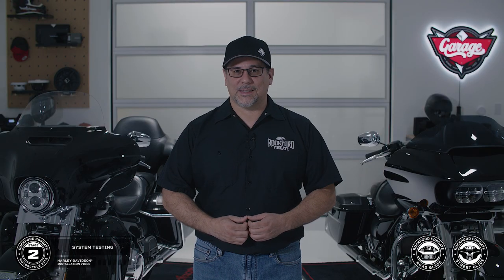Now we're ready to test the system. If you haven't had the factory Harley-Davidson radio flashed, now is the time to do it. Refer to your tuning guide for testing procedures and make any adjustments as needed. If your radio is not flashed, keep the volume at a minimum or you will damage your speakers. You can also find a list of dealers that can flash your radio on our website at rockfordfosgate.com/dealer-locator.